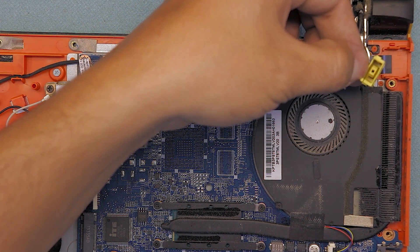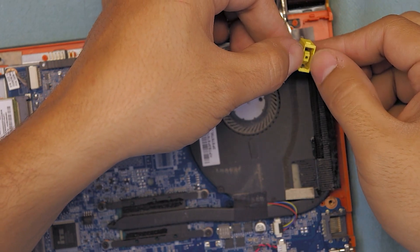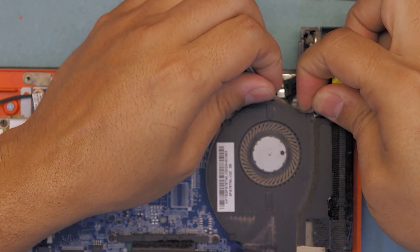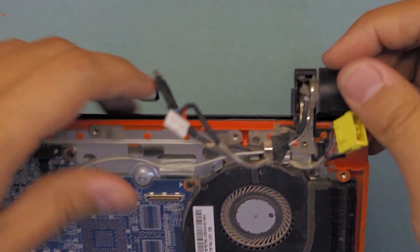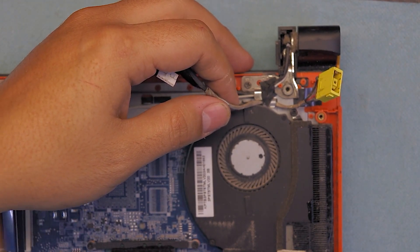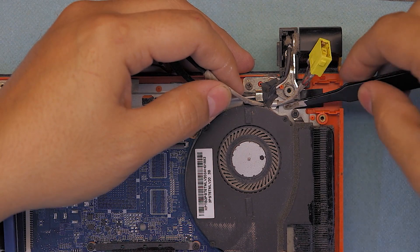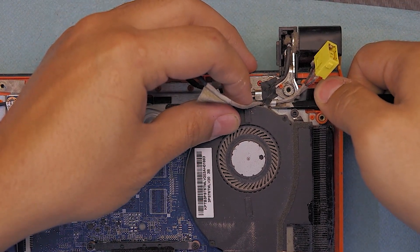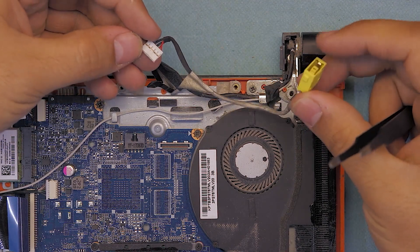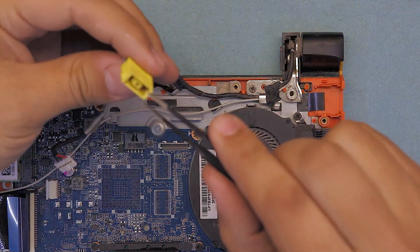The camera isn't focusing well, but the jack is broken. To remove it from the chassis, just unhook it from the metal clip down there. You can lift up the metal cover here to make it easier, and push it back when done. This is your power jack — I'll leave the model number in the description. You can buy them on eBay; they're really cheap and easy to replace yourself.